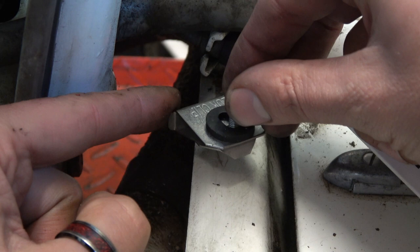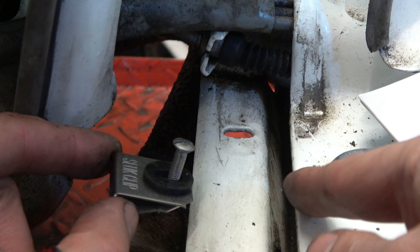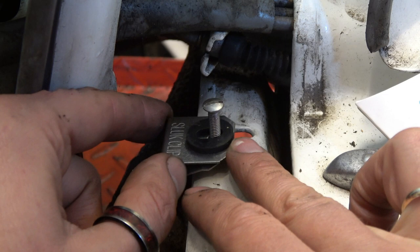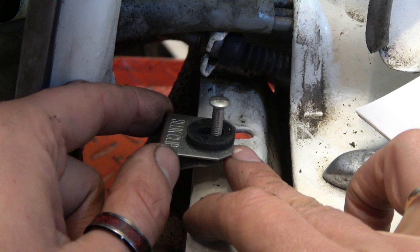There's a slot here, and that's to allow for the fact that your bodywork could be positioned slightly differently depending on how the leg shields are screwed down. There needs to be some variation in how the running boards fit, and the whole point is that this is a floating nut — it can go forwards and backwards in the slot.